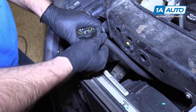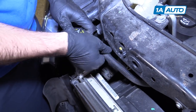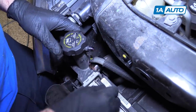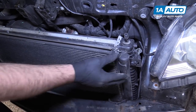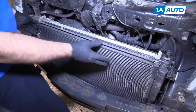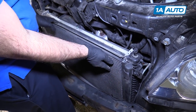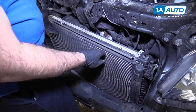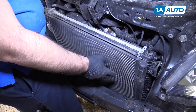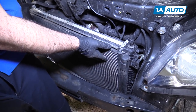Need to get this one off too — it's just a barbed fitting with the hose on it. Pull that right off. The radiator is pretty loose. It is snapped into the condenser for your air conditioning. Be very careful with this — you don't want to damage it. If you puncture it, your Freon will escape and you won't have any air conditioning, and you'll have to have it professionally replaced because you need specialized equipment to deal with air conditioning.